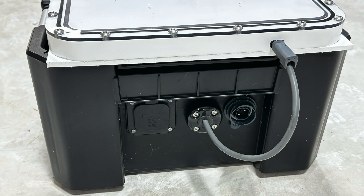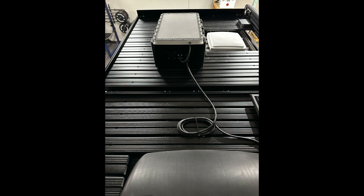The case is all closed up now. You can see the final cable going from the box into the Starlink, the Starlink installed on top, and the gland seal fully in place — it is all watertight and ready to go on the van. On the van, the case is mounted with the standard Wolfpack mounting kit from Frontrunner, designed to mount on the Frontrunner rack, and you can see the DC cable running to where the Storyteller Overland van has DC available at the roof.